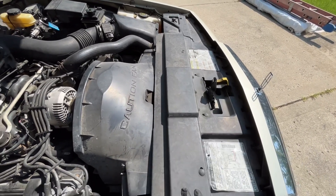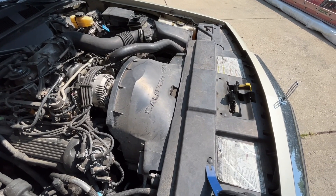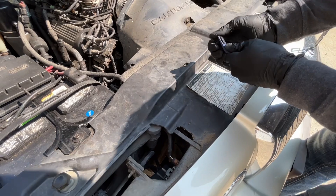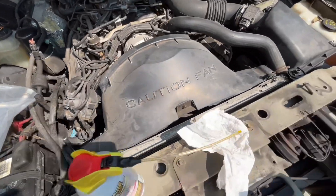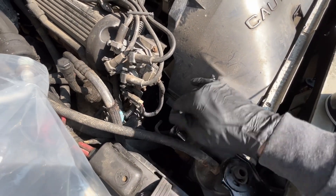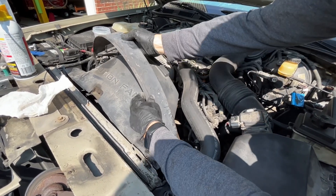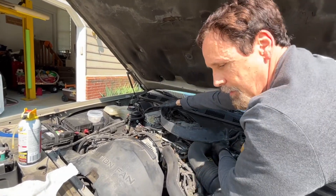Our first step is to remove some of this plastic work here to get access to the top of the radiator and the condenser. I'm going to use one of these trim removal tools to get these plastic pieces out of here. You can see what we're doing to get these guys out. The first step is going to be to pull this shroud out — there's a bolt on this side and another bolt on the other side, 8 millimeter. There's a piece of plastic that slides out from underneath, which allows us to pull the whole assembly up without getting stuck on the fan blade.